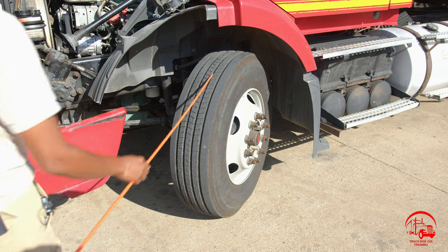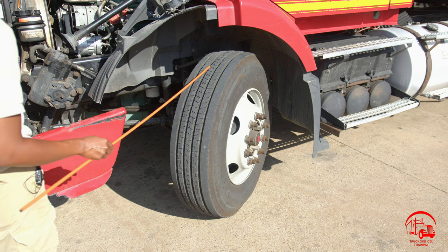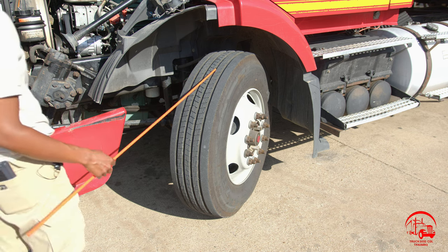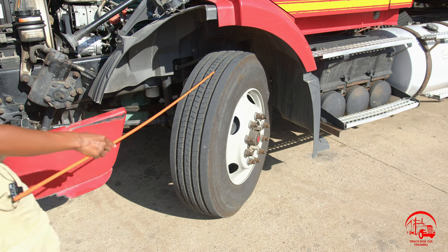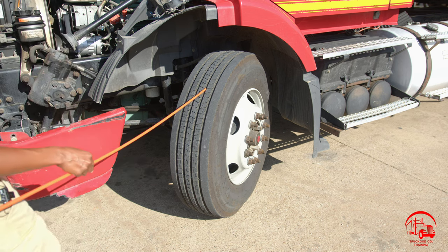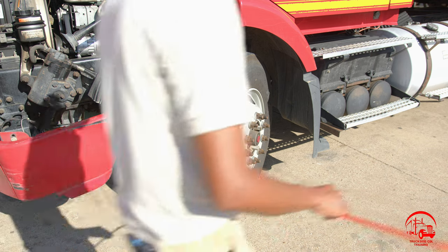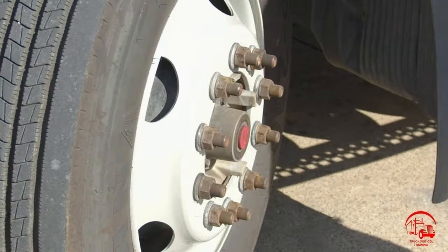Then I have the top of my tire. It is properly mounted and secure, not bent, broken, or cracked. There are no abrasions, bubbles, cuts, or dry rots. They are virgin tires, evenly worn, with no less than 4/32 tread depth, and there are no leaks.